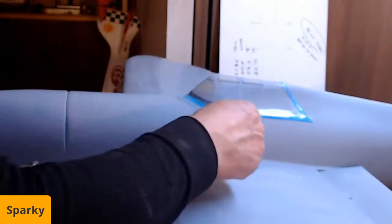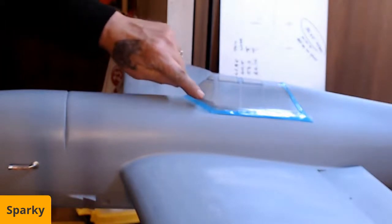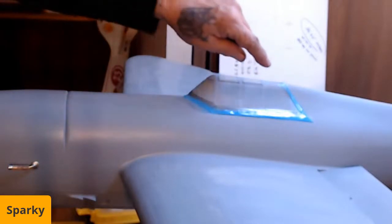So, as predicted, I said about 10 o'clock, and if I'd have done it at 10 instead of 10:30, I'd have been all right, but it'll be okay. So like I say, we'll take a small block, a bar sander, and sand that straight. I'll put a piece of tape on it again. Then I'll take my polywog and detail sand this, and I'm not sure how I'm going to attack the back. Probably my small soft block, this soft block here with 180 to get in there.